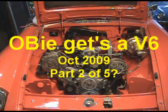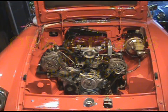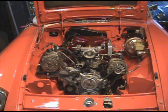A couple of items that were really a pain to slip fit: the secondary cross brace, trying to get the tail cone of the tranny up over that while still getting the transmission back in far enough. The hump on the T5 actually hits the ceiling of the tunnel in the firewall — a little clearance there would have helped install, but right now there's probably a quarter to three-quarters of an inch free play, so that's not a real issue.